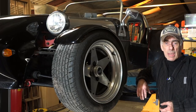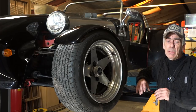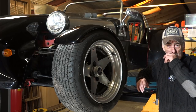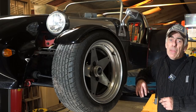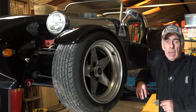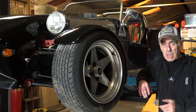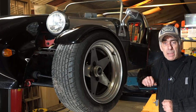Then of course there's the fuel — that's another issue. The fuel will be spoiled over all these years, so I'm not even going to try to run it on what's still in there. I need to drain the fuel, flush the hoses with fresh fuel through the fuel pump, possibly change the fuel filter, and maybe open up the carburetors. Then I'll do a compression test on all cylinders and an ignition test, and then try to crank it over after replacing the battery.